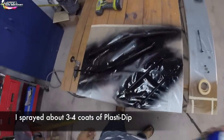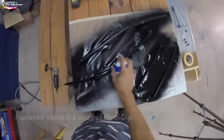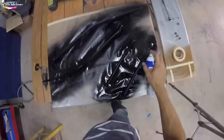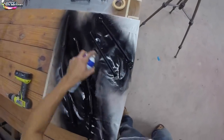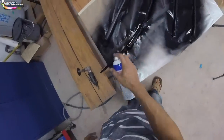I'm putting three to four heavy coats on it, making it look nice, so when I put them on the cab it looks great. Let's just wrap this up and then we're gonna be putting on our tailgate. We're getting close to assembling the truck together, and then we're gonna be doing our color sanding and buffing. Remember, you could always do the color sanding and buffing first.